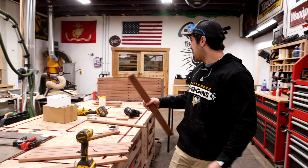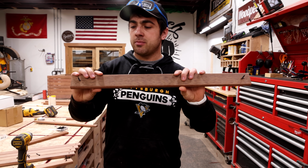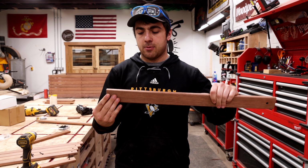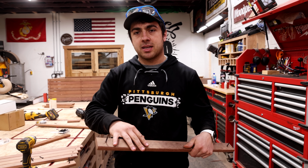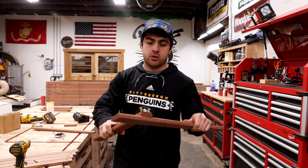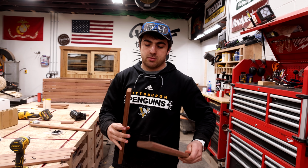We gotta make the access panel. We're putting the screws in and then we're gonna cut them down with a cutoff wheel or grind them down. That way the outside looks the same, and then we're gonna countersink some magnets in there to make the hatch, and it should look pretty sweet. Brad nail and face glue this whole panel together, and that should be plenty sturdy.